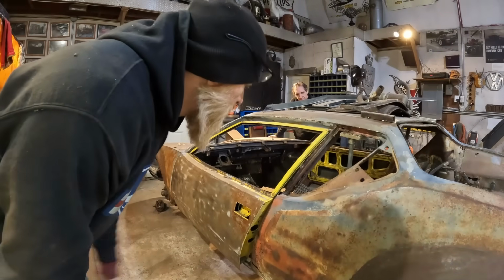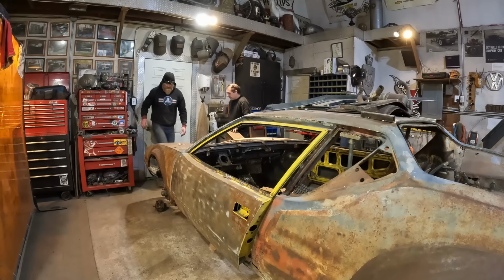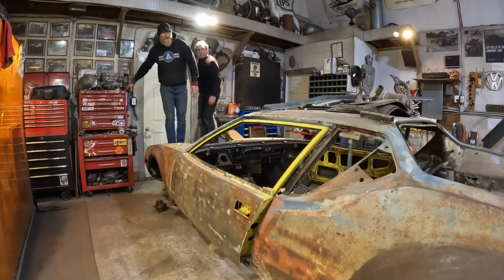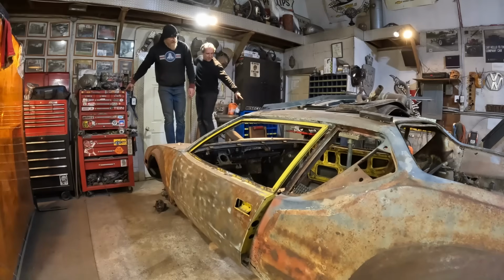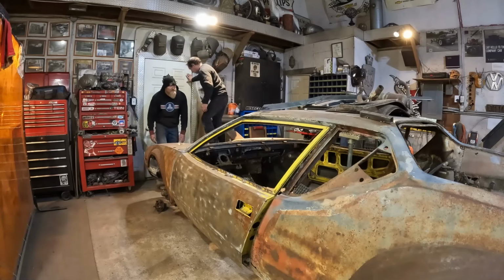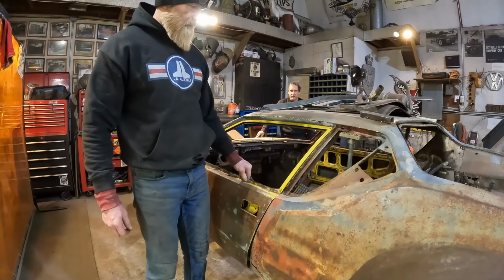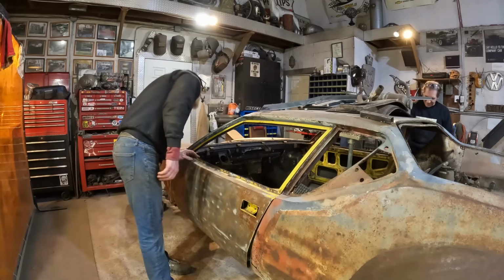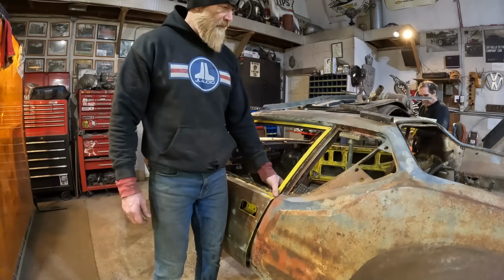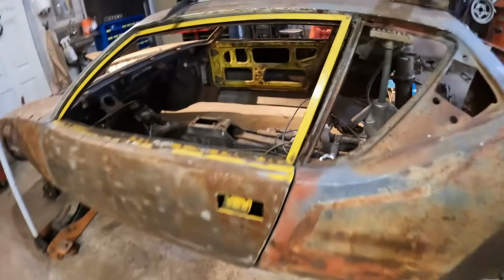So Dan and I are going to bounce on the front of this thing and see if we can get this door post to come up a little bit and see what happens. Oh shit, this one almost... Because even if it's too high, I need to adjust that one down, so... Yeah, it's perfect. This has just got to come up a 1/4 inch now. Way better.